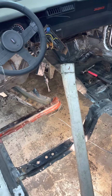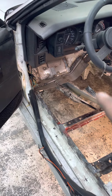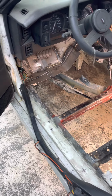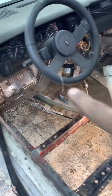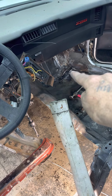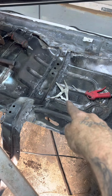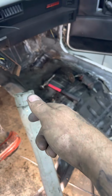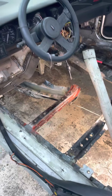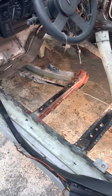It's coming along. It's a pain in the ass, but that acetylene torch really helps you out, because trying to form that metal and beat it all in there, when you heat it up with that torch, it just goes in there so much better. Especially when I had to make that long strip to go all the way around there. That's one continuous strip. So I started back there, got my tacks in there, and just kept heating it and beating it down. I had some Harbor Freight needle nose vice grips and was clamping it down as I was going all the way down, just keeping it tight. Then like I said, once I got it all tacked in there, I got underneath and solid welded it out. I'll grind all of them welds down tomorrow and get it all cleaned up.